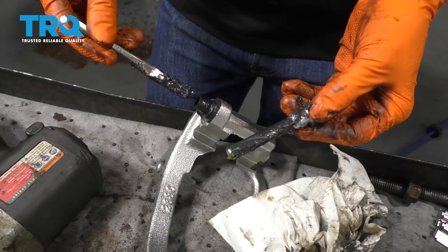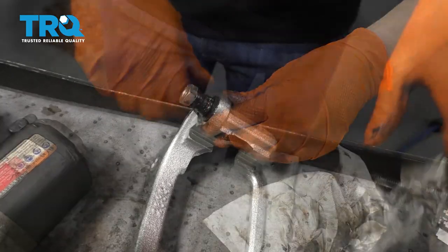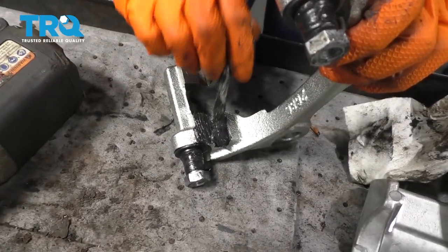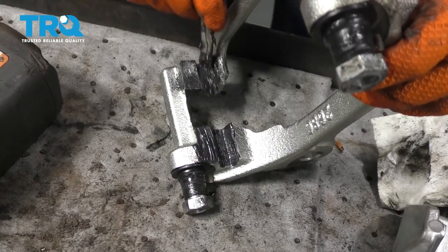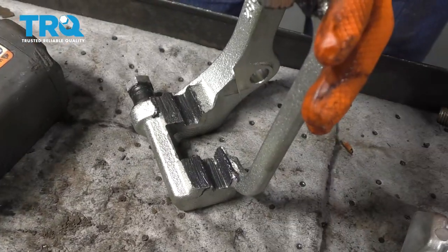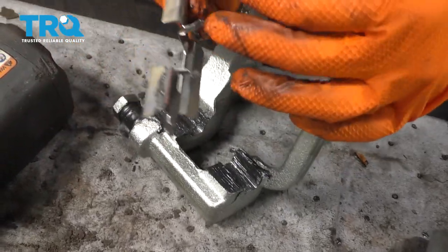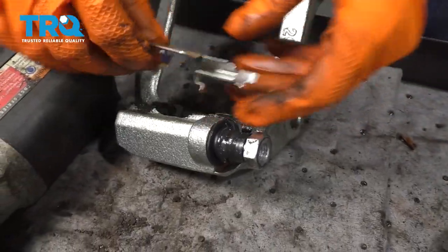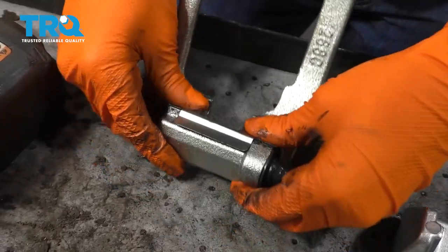If you want, you can add some grease right into the boot, slide the pin in, and give it a few twists. The next step is to add some grease right where the hardware is going to sit — not a lot, just a thin layer. If you put too much, it'll squeeze out and go onto the rotor and then you'll have issues. Do that to both sides. Then take your new hardware that should come with the caliper, line it up, and press it on. These little spring clips have to go on the inside. Do that to both sides and press it down all the way.